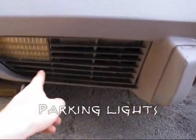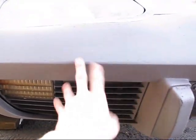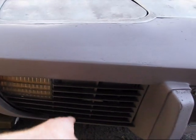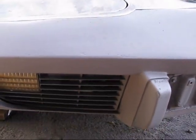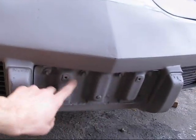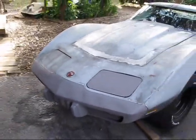The front looks a whole lot better too. Instead of trying to tape off all the plastic grill pieces, I just taped off the headlights and painted over the grill because the screws are rusted shut and I'd have to drill them out. I can always re-coat them flat black, satin black, or green later. I also took off the license tag bracket up front and sprayed this metal piece after scuffing it down. This bumper still needs some spot putty and work, but it looks a whole lot better.